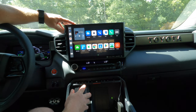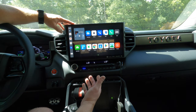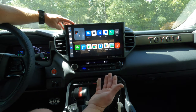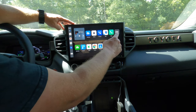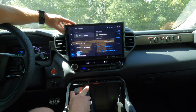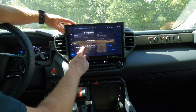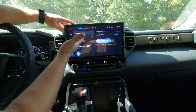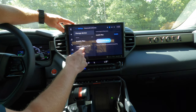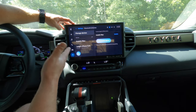If you do want to go back to just standard CarPlay and not use the Benees box, you can do the obvious which is just unplug it, or you can go back to your truck settings. Click on the home icon, takes you back to your truck settings, go back to Bluetooth and devices. The same way you connect to the box, now you can just go back to the iPhone. You can switch back and forth relatively easily.